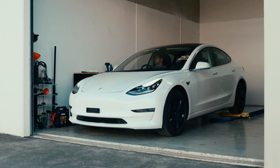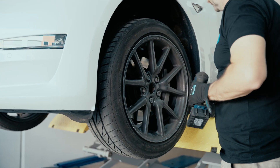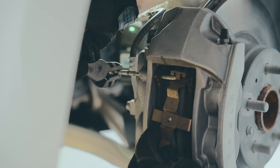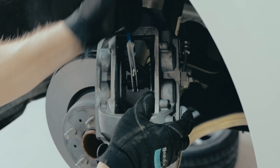To replace brake pads on the Tesla Model 3, start by raising the vehicle and removing the rear underhood apron underneath the bonnet. Once you've removed the wheels, take the brake pad retaining pins and anti-rattle spring out of the caliper and slide the brake pads out. Then push the piston back into the caliper using a caliper spreading tool.